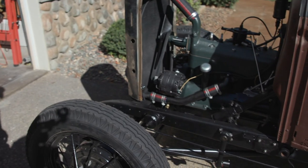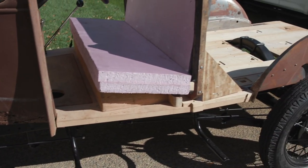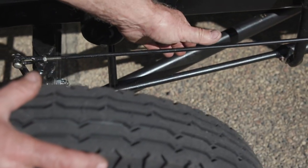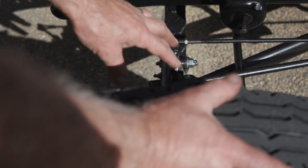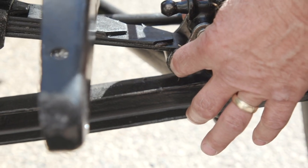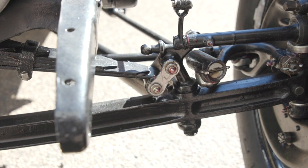Well, yeah, we have the chassis done, as we mentioned. We just continued to work on things. I mentioned we started with the frame, then we put the front axle, the rear axle, the springs all together. But part of that whole situation was to get all the brakes and brake rods set up. So we've got a brake rod for each of the front wheels, one on each side, and we've got the anti-rattle springs that keep it from rattling, and all the suspension. And part of that was we had to get the tie rods all adjusted. We had to get the toe-in correct. And of course, the springs, we had the shackles and the nuts and also the cotter pins that go on there. And so everything's all set to go with the front end.